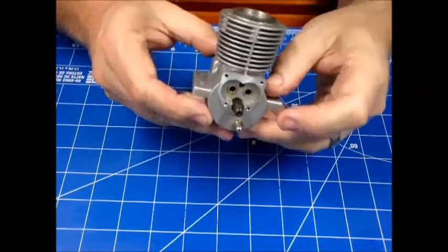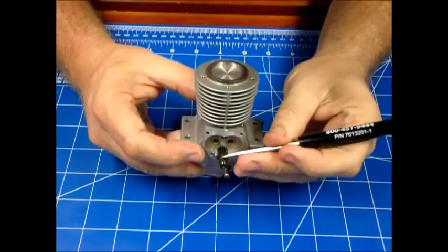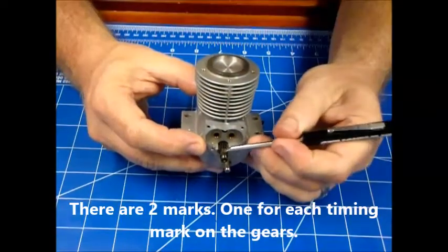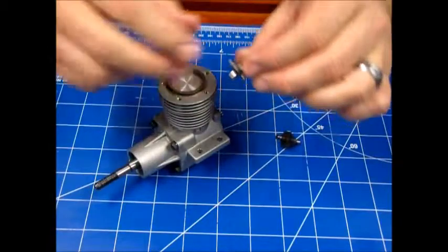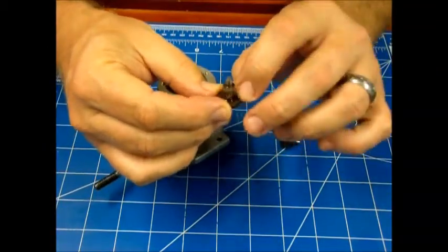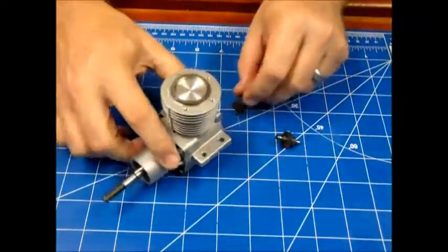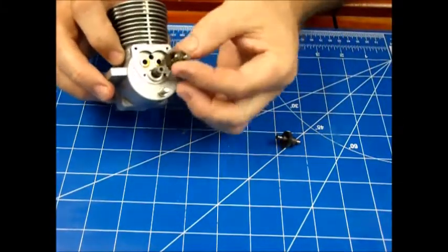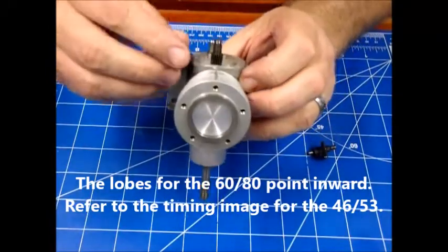With my magnifier on — and obviously you can't see this, but I'm going to try and point it out anyway — there is a mark, a notch on this shaft right here that indicates top dead center. It kind of looks like you could go up a little bit higher, but that mark on that shaft needs to be straight up. These gears have a timing dot on them and they have to line up — that timing dot as it lines up here is going to point right at that notch.